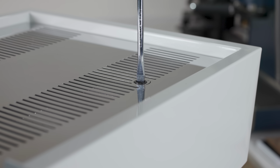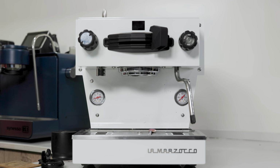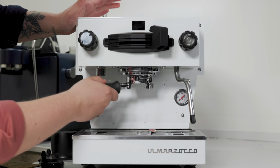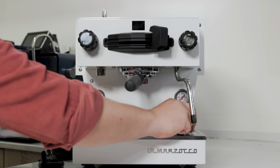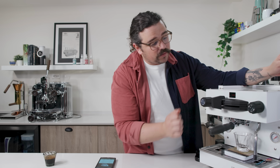If you are a really gifted engineer that really likes La Marzocco and doesn't mind making something, you could probably make some sort of suction cup something to stick right there that has a little Phillips head and can do it mechanically, you know? Who knows? People are crazy. I've seen much crazier modifications than that. If you want to do a decreasing shot and use your hand to twist as you're going, okay, I'm gonna go ahead and start the shot. It'll do the 6-second pre-brew, 9-second pause, and then I'm gonna mess around with the screw going counterclockwise to decrease pressure. So here we go.